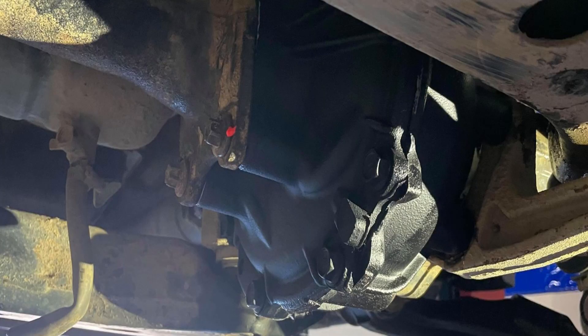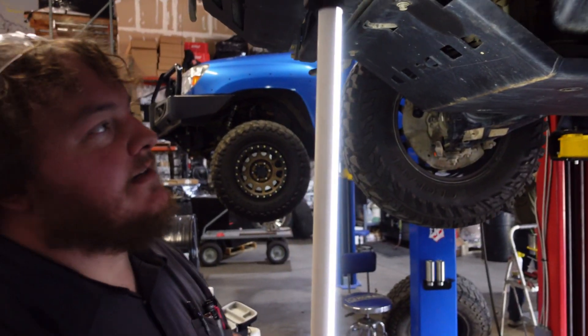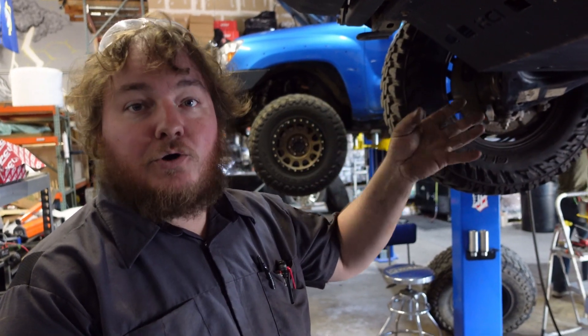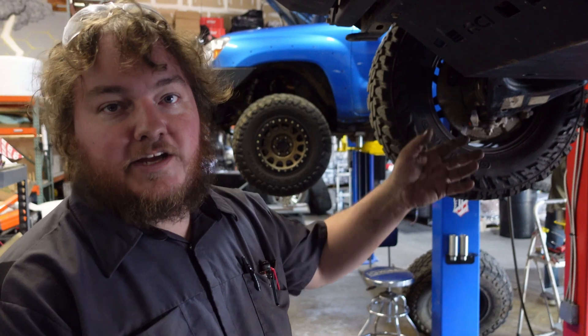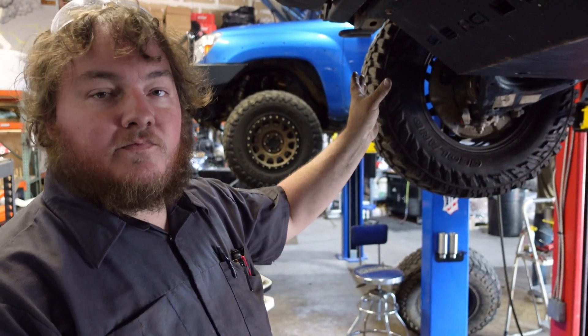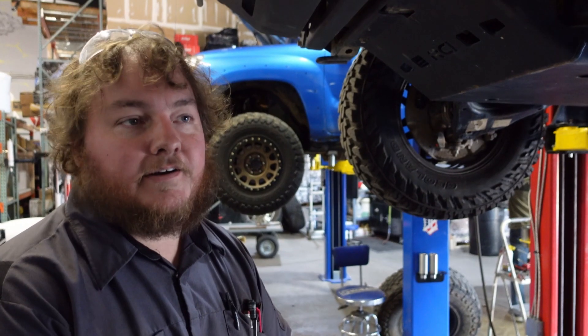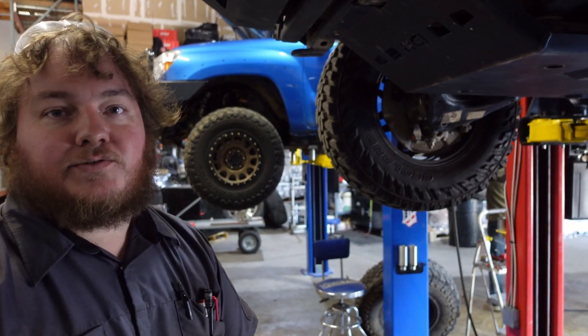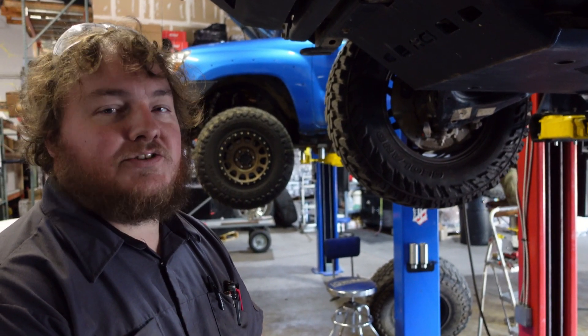The diff is probably going to be a little hard to see, but I did go with East Coast Gear Supply to replace the front diff. We did an East Coast Gear Supply front diff to match the 4.56s that were in the rear. It's still open in the front, which is completely fine with having the center locker and this new e-locker. It's an all-new clamshell — we reused the torque arm from the factory diff and reinstalled it to the new diff. Everything's pre-loaded with new seals and new bearings, filled with new fluid, and we've gone over the break-in procedure.